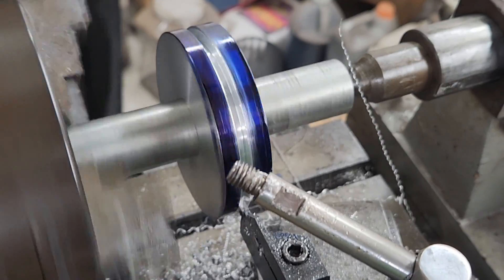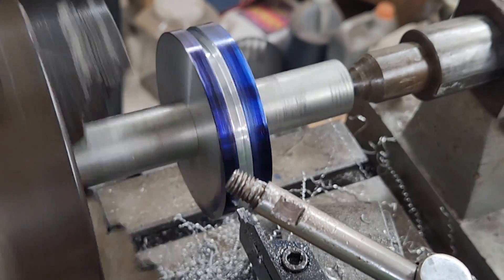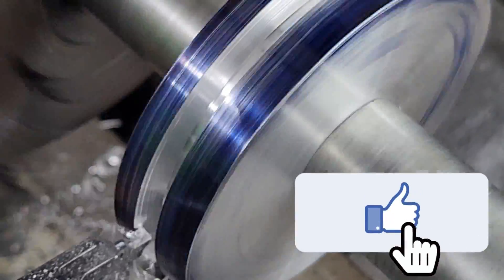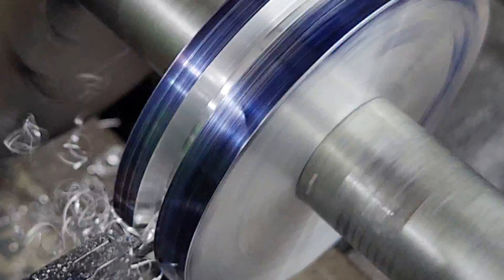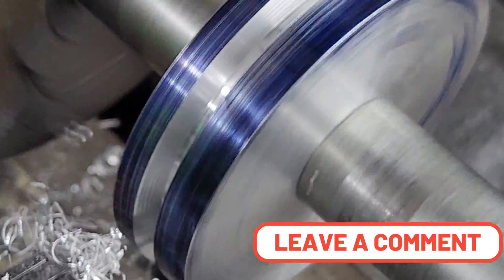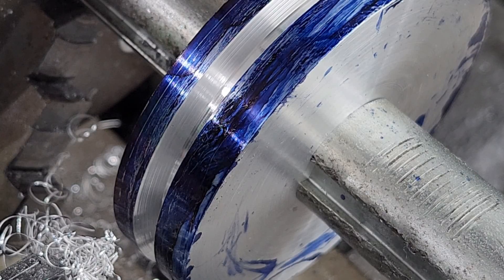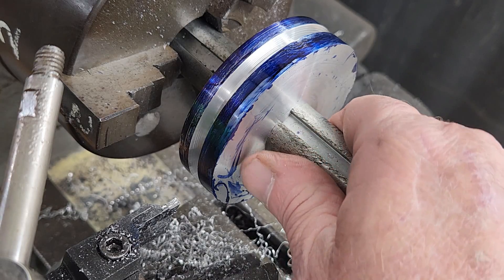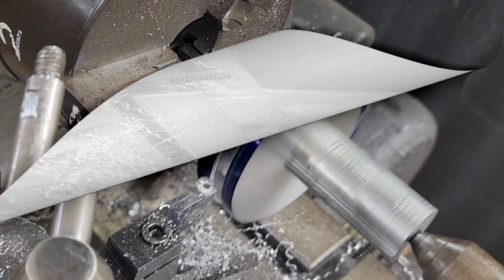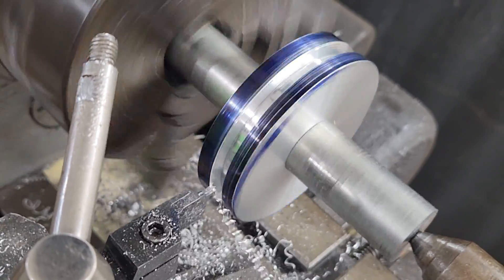This compound cut is very satisfying. The hardest part of making a V-belt pulley is cutting the angle, and if all the measurements are right, it's a breeze. This is a nice skill to learn in order to make custom pulleys in the future. Of course, with 50,000 people watching, I'm sure some of you would say I'm doing it all wrong. But keep in mind, this is the first pulley I've ever made, and to show you that an idiot can do it, I'm doing it on camera. This side is cut, and now we have to cut the other side. Unfortunately the arbor's too short and we can't reposition the tool post, so we'll have to flip the workpiece around in the lathe. Flipping the part around in the arbor introduced a bit of a wobble, but the good news is I don't care — I do have a plan for the next time I do this.